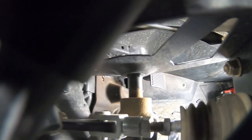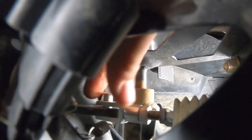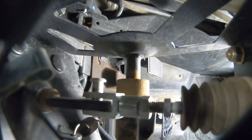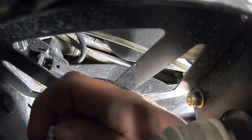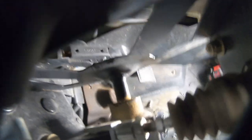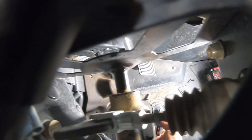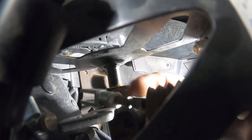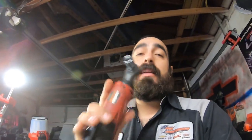I'm going to have to remove the pin for the master cylinder. There goes the pin. So there's the pin removed. And now you should be able to see that your pedal is going to be nice and free. You can move this out of the way, just making sure you don't pull this out of the master cylinder by accident. Then you will take your nut and bolt off, which should be self-explanatory. For the bolt, you're going to need a 15mm wrench and a 15mm ratchet and socket. If you don't have an electric one, no big deal — it'll just take a little bit more time.